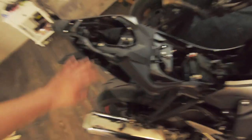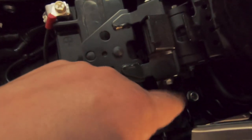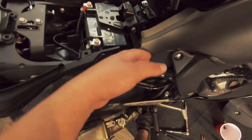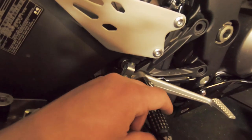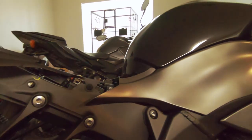Update — I had to remove this fairing, and this whole fairing right here is one piece to get the servo cables fed out. I loosened this 10mm right here, which is a hanger for the servo, just a little bit, not all the way. Then I fed one cable at a time underneath it. I did have to pop this fairing back — not off, but just pull it back — and then you just push it in and you'll hear it click back into place. Since I have to remove the foot peg and rear brake set to put the new hanger on, I went ahead and removed them so that this is hanging free. There's a hanger back there, I popped each cable out of it, fed them from the top of the tank down to the bottom, and they are now completely free.